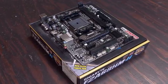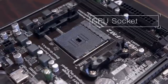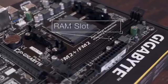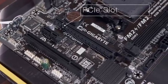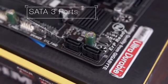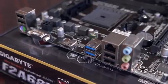Let's take a quick look around the motherboard — basically everything in the build connects here. The gray socket in the middle is where the processor is installed. To the right of that are the RAM slots for memory, and on the bottom are the PCIe slots which is where we'll be installing the graphics card a bit later on. On the bottom corner you'll find two of the four SATA ports to connect hard drives and SSDs. Most of your ports are on the back side which is where you'll plug stuff in at the rear of the case.